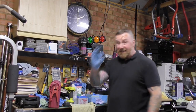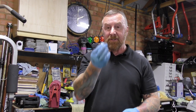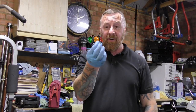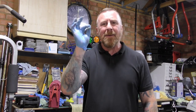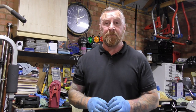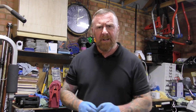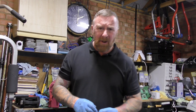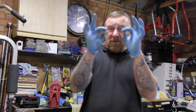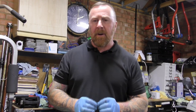Just after I cleaned this little jet, I thought I'd have a look at the number stamped on the side. My eyes aren't what they used to be, so I used the zoom on the phone — it's a 50. It had been down-jetted. These are standard 54 or 56 — I've seen both in loads of them. Not 50, that's really really small and would have been causing smothering, just not enough fuel.